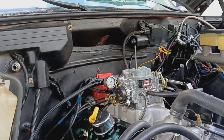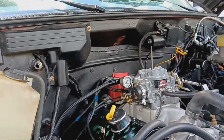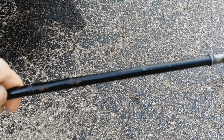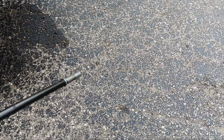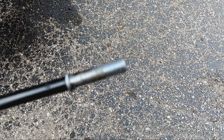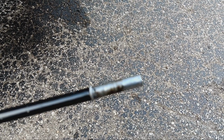So another issue he had was with the dipstick tube. The part of the dipstick tube that enters the engine block, down here, is actually about 5 inches long. This is a junkyard tube. The dipstick would go in, and there's a windage tray in that 7-quart pan right where the trap door is. The dipstick tube would go all the way in, and it wouldn't align, and then the dipstick would come down and hit and go on top of that windage tray, and it wouldn't go through the access hole to go down into the sump, so you could see how much oil you had in there. So I cut this one down to about 2 inches long, put the dipstick in, and it read right. So at that point, I ordered a brand new tube, because I cut that off.